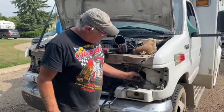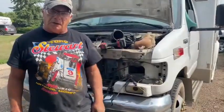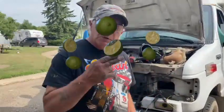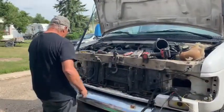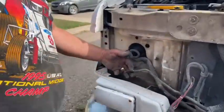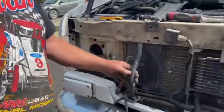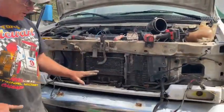Now the right side turn signals isn't that bad because it just goes in and goes parallel. Anything going parallel you can cut. Anything in series you have to put back together - and that's what we have to do here. Same as over here: this is parallel, so we'll just cut the green wire. Now this main harness goes around and comes into this one. We've got this just about unhooked now.